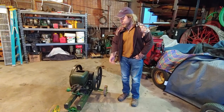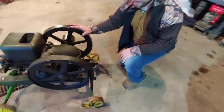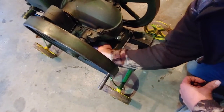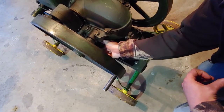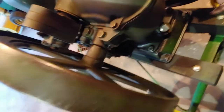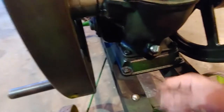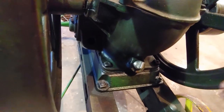There are a couple of things to check on these. There are two points on this engine. First is going to be this one — it's going to be a little tough to see in here, but this is your oil fill port, which also serves as a check. The John Deere engine would be outfitted with a funnel from the factory. There's going to be oil on the bottom of your threads. As long as there's oil on the bottom of your threads, you're okay.